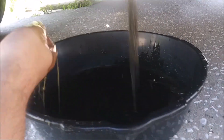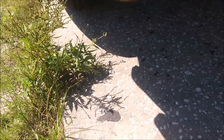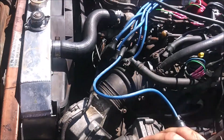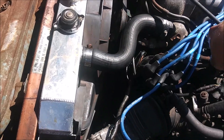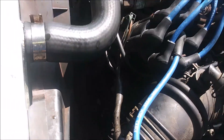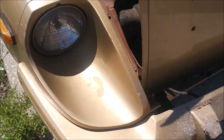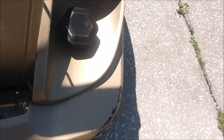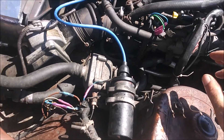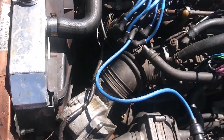I'm not worried about the drips on this stuff because it's apparently biodegradable. I'll go ahead and drain it out. After that I'm going to pull the upper radiator hose off — there are several holes in there — and circulate some water through to flush most of the rest of it out. I'm probably going to get a milk jug to collect this because apparently I could use this stuff for restoring old tools.